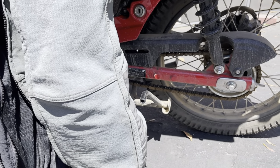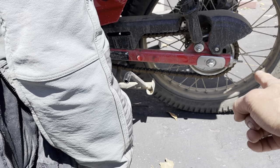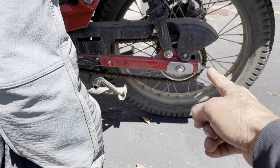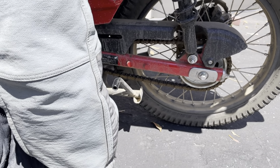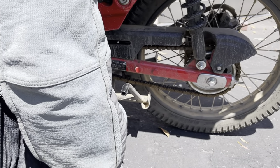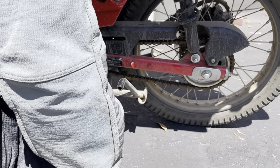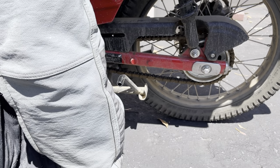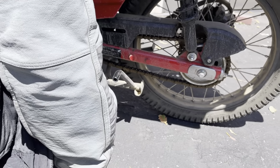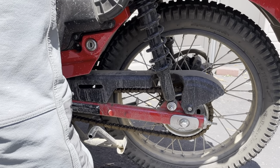This setup is the best tire setup I have so far compared to all the others I've tried, as far as sizing goes. I'm still not sure if I want to keep the 2.75 in the back or not. I think I might, and just put in a one-tooth larger sprocket in the rear so I could get better dirt gearing. On the street it feels fine right now — it's just a little bit on the tall side. Anyway, I need to start doing other stuff to this bike — I have a whole bunch of things, like the lights and other stuff.